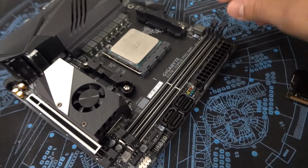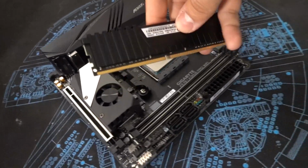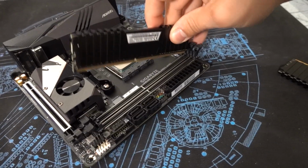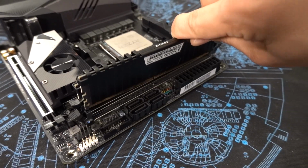Memory sticks, memory sticks. You know, on a serious note, if you're gonna do a balls to the wall mini ITX system, you might as well go with 16 gig sticks because you only got 2 DIMM slots to work with, people. If you go 8 and 8, there ain't room to grow, honey. Or if you're really crazy, you can go with 32 gig sticks, but that's just too much.